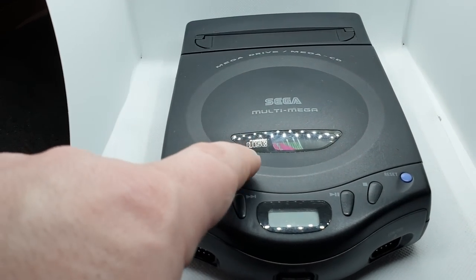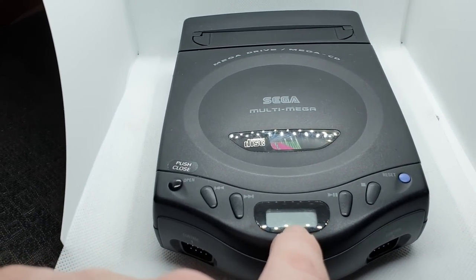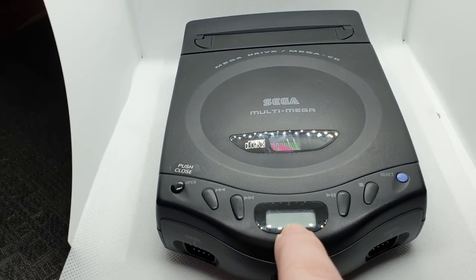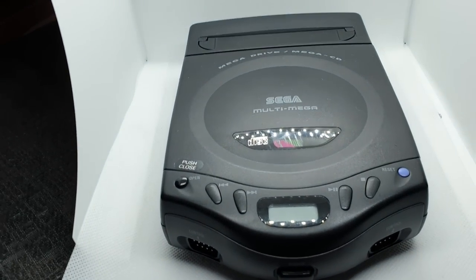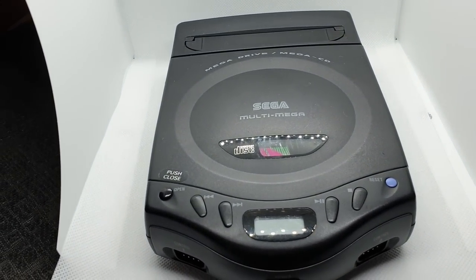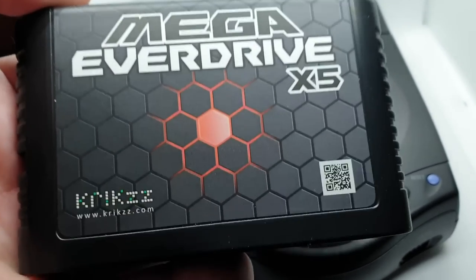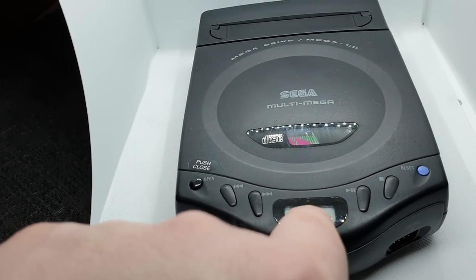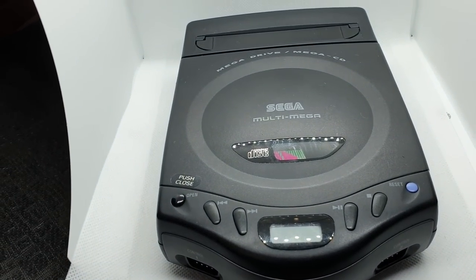He's added a 60Hz mod as well. This LED on the front is orange when powered on as standard. If you hold the reset button it goes blue — blue means USA. Hold reset again and it goes green — Japanese mode. So it will play any region cart you throw at it. For Mega CD games, power is standard orange, but with the Mega Everdrive you can put the BIOS files on the cartridge, plug it in, and when you turn it on it loads up the Everdrive menu. Select the BIOS you want, set the LED to blue for USA, press A and it'll boot up as if it was an American system — same for Japanese.